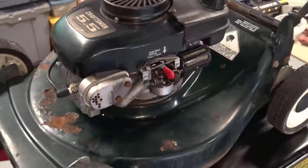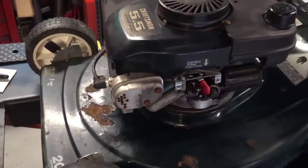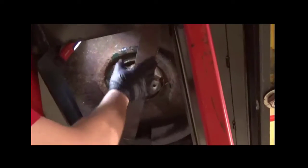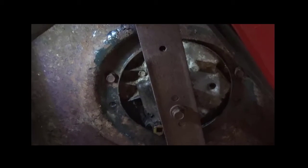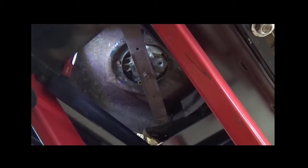You'd have to go through Sears.com to get parts for it. It's a very basic engine with basic controls, and not a lot of value to this mower. Rather than try to rebuild it and get it going, we've chosen to use this as an example for disassembly. I have my safety glasses on because we're going to be underneath the mower. You can see the underside here - here's the lawnmower blade, which has a decent amount of wear on it. There's our drain plug bolt for the engine, and these other bolts are what hold the engine to the mower deck surface.